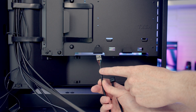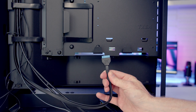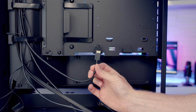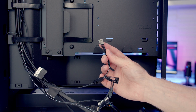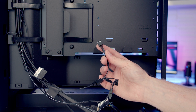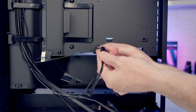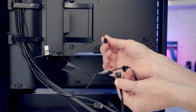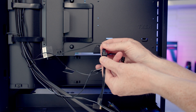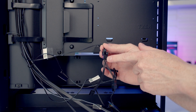The case cables include an HD audio cable, front panel connectors organised into a single cable, a USB 3.0 cable, and a front panel Type-C cable. The front fans are connected via a triple splitter, so just one 4-pin PWM cable needs to plug into the motherboard to control all three fans. Importantly, since the fans have 3-pin connectors rather than 4-pin, they must be run in DC mode in the motherboard BIOS.